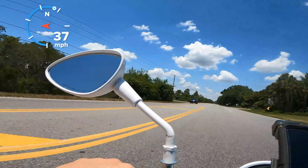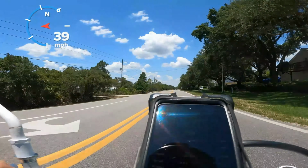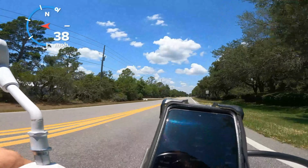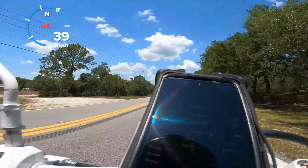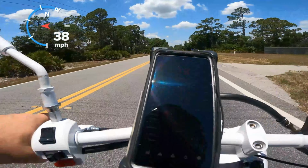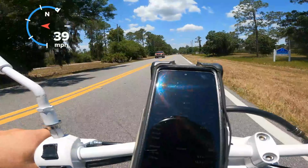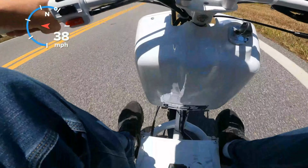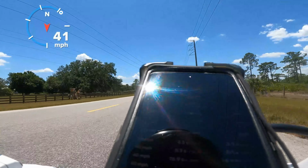All right, with the rollers, I'm already at 38 and 9,000 RPM, so that's much better. The RPMs are more in check. And at 38 miles an hour, now I'm increasing speed as that's gearing up. It's pushing that variator out further. So the sliders were 11,000 RPM. I'm at 9,000 RPM. And the sliders were stuck at 37 miles an hour. The rollers apparently are pushing that plate out further. 8,800, can't get the RPM at 42.